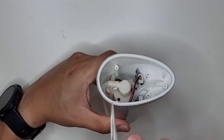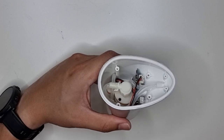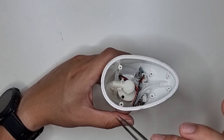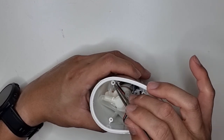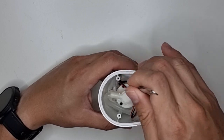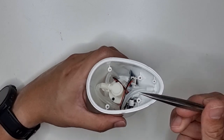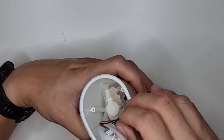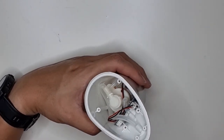If the bend radius is too sharp, then a kink might be created, and that acts as a pinch point which constricts the flow of soap, and that could cause a troubleshooting problem later. So despite having shortened this tube so that I can cut a small piece out to serve as the air intake, I had to be careful with looping the tube around in such a way, as you can see, to have a large enough bend radius so that no kinks are created, right?